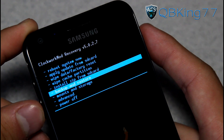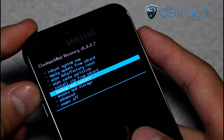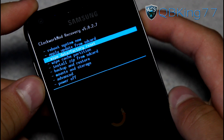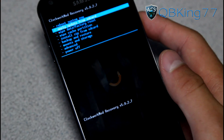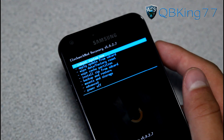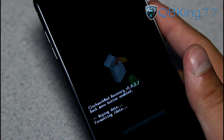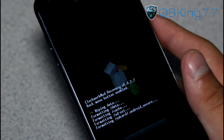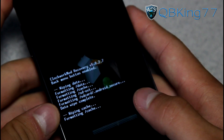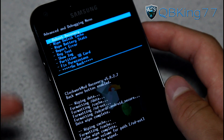You can make a Nandroid backup by going to Backup and Restore if you'd like — just make sure you're on the same recovery to restore it later. To install the ROM, go to Wipe Data Factory Reset, press the power button to select it. Note: in this recovery you need to enable the power button by pressing Up, Down, Up, Down until it says 'back menu button enabled.' Now go to Wipe Data Factory Reset, hit Yes — Delete All User Data. This will wipe everything, so make sure contacts, apps, and everything important is backed up. Data wipe complete. Then go to Wipe Cache Partition, hit Yes. Then go to Advanced and hit Wipe Dalvik Cache and hit Yes. So wipe your data, cache, and Dalvik cache.